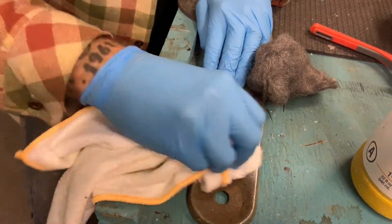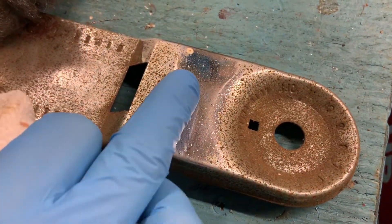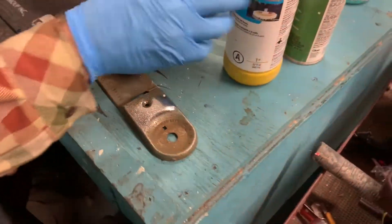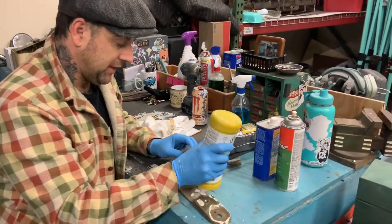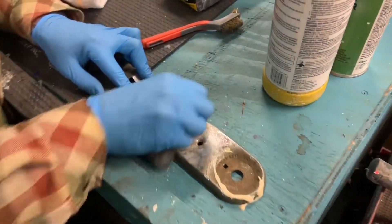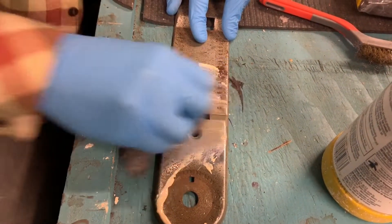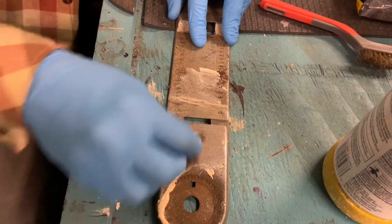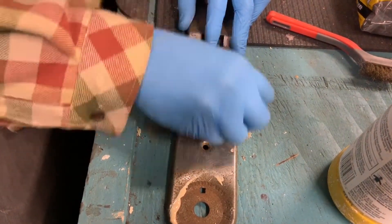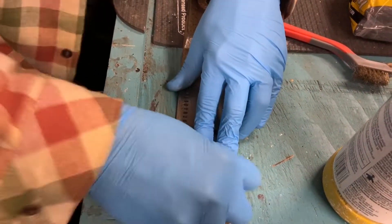There's going to be a film — you wipe it off and you can see even just with that one pass the difference it made. You can see the little tiny dots in here — that would be the pitting, but like I said you can't get that back. If you want to get rid of that you've got to replate — take it into a chrome shop. But if it's just something you want shiny and not rusty, this is what you're going to do. It's real easy and really satisfying. I'm just going to show real quick on the other half and then show you a couple of the other things I use.